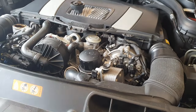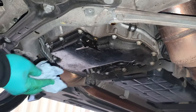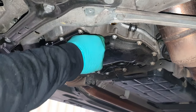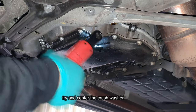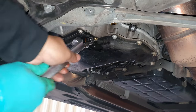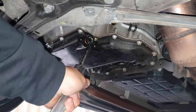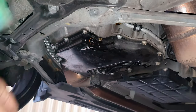Check out this handy oil filler cap tool — it's a little clamp that sits on top of your oil filler opening, about five dollars from Temu, and it holds the funnel straight for filling. Now that the oil is fully drained, grab a cloth and clean up around the sump plug, making sure the threads aren't dirty. Hand-thread it first to avoid cross-threading, then use the 13mm spanner to tighten it — go upwards to tighten. Get good leverage and pull up until it's nice and snug — don't go too tight. Double-check it's tight.